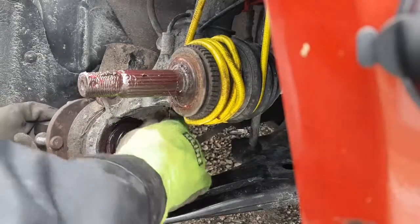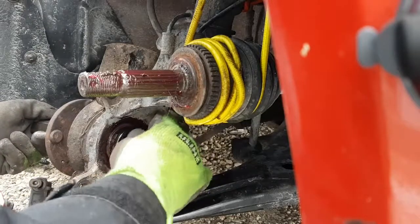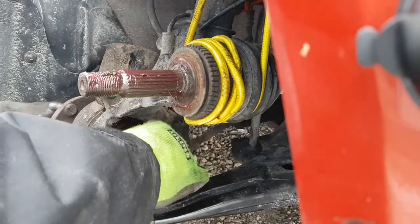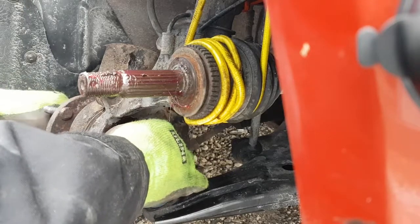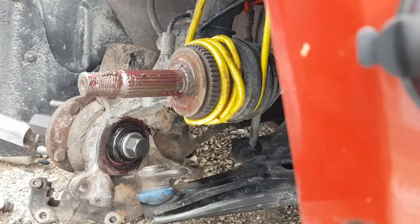And then the same thing as I did with the rest of them. I'll set the torque wrench so you get an idea how much torque should be on this when you put it in, like how hard it should be to turn it. And we can turn this around and make sure it's somewhat straight. Torque wrench. Turn this down to maybe 30 again. Okay, there's 30. There's 30 foot-pounds on the torque wrench.